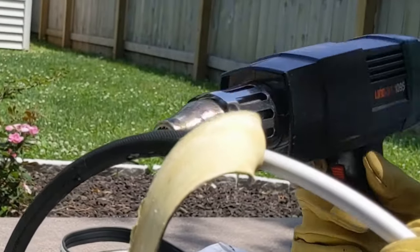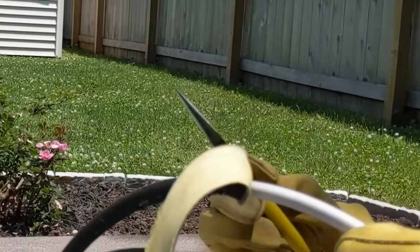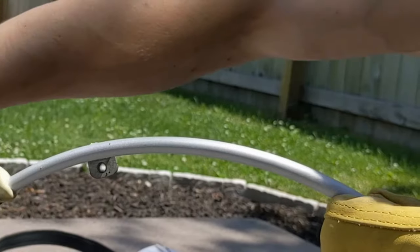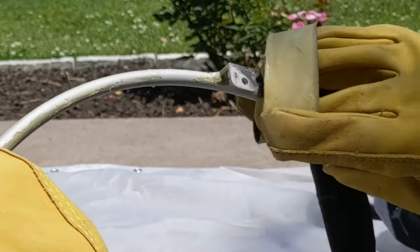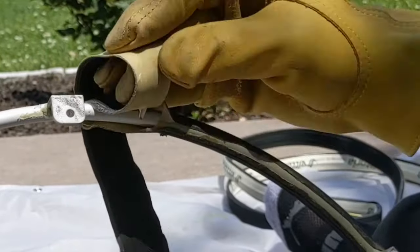You want to repeat this process of heating and peeling until the tire is off the whole ring. Often the adhesive comes off nicely with the tire, except along the back edges where there is no tire covering the adhesive. Again, just tack that off. The key to the glue coming off cleanly is heating the tire to the exact right amount. Not too much, not too little.